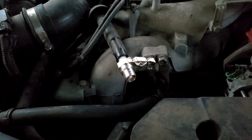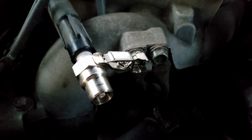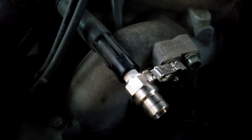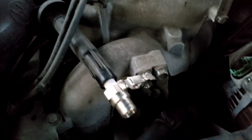With the spark tester connected, we do know that the ignition coil is sending a spark signal and the wire is transmitting that signal to the spark plug. If we weren't getting any spark, we'd want to trace the problem back to either the spark plug wire, the coil, wiring, or the computer. But unfortunately, since it's only a random misfire, tests like these won't tell you where the problem is, because they only happen at random moments, not the whole time.